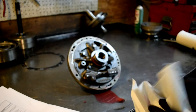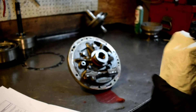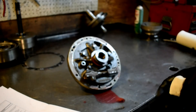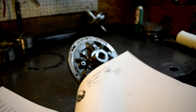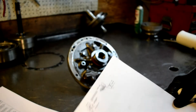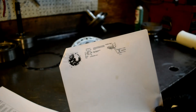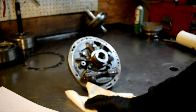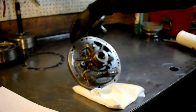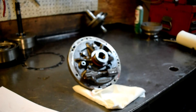This seems to be primarily in some of the bigger engines of the time. The 727s in Mopar have also had this problem. So we're going to do, via the instructions here, a little update to the pump that supposedly bypasses this pressure — kind of like a pressure relief.